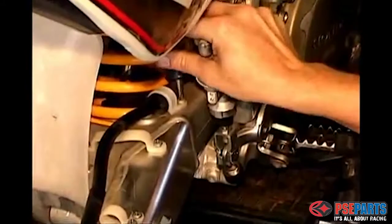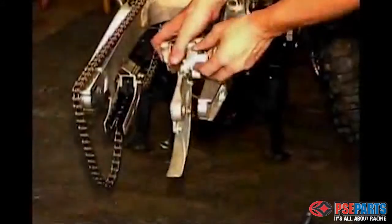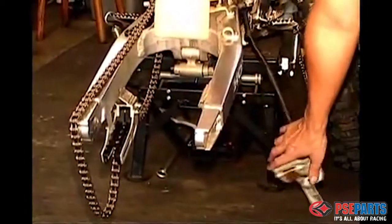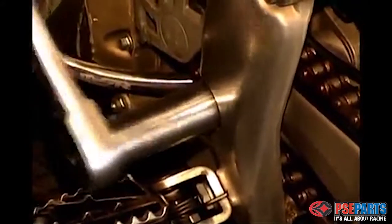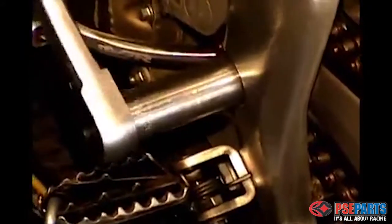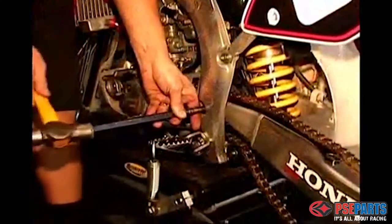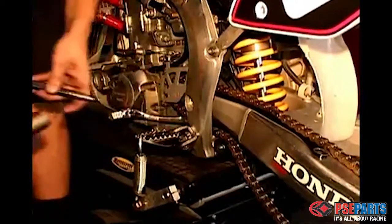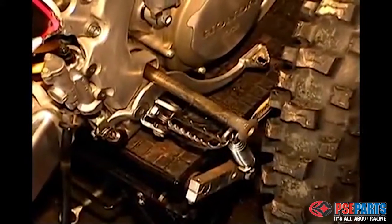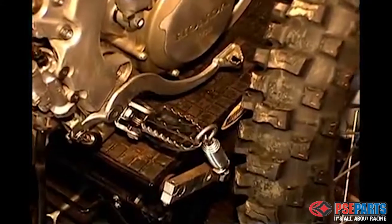Begin by removing the rear wheel, brake assembly, and the chain. Next, remove the swing arm nut with a large socket and ratchet. You may have to use a punch or some other blunt object to carefully push out the swing arm pivot bolt. Do not mess up the end of the bolt. You might also strategically place someone on the other side of the bike.